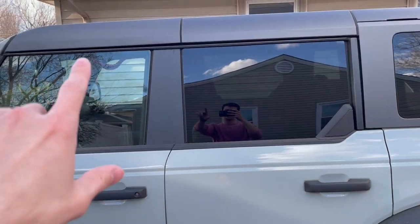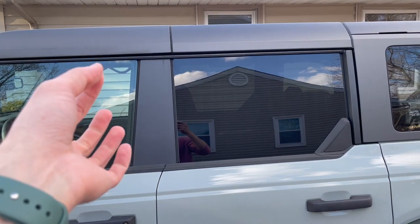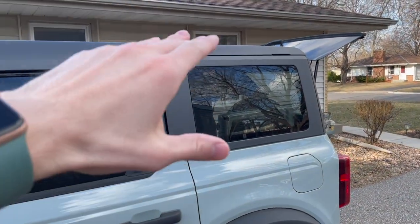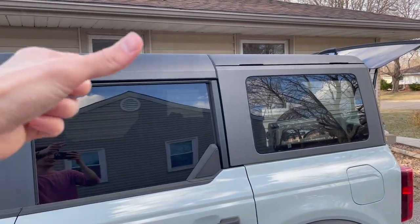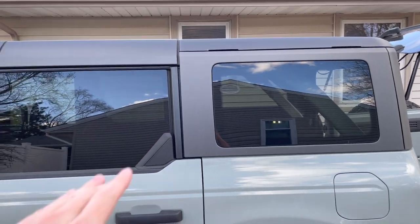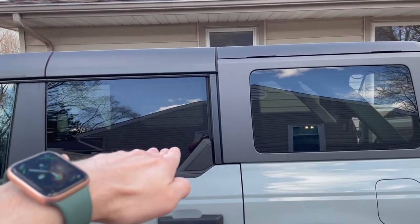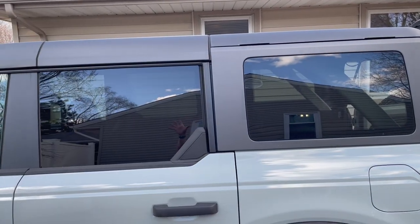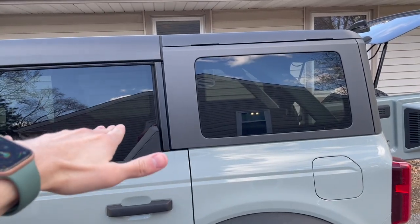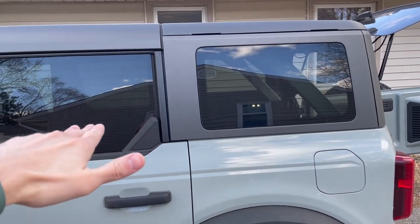This is not the same thing as the rattling with that pin in the front. What I'm talking about is the actual hardtop itself, because these panels are so big and because they're not secured to the roll cage, they actually tend to reverberate. This isn't outside noise coming into the cabin — it's the actual roof itself kind of shaking and making this wub-wub-wub sound.